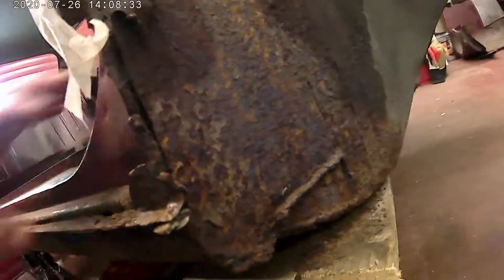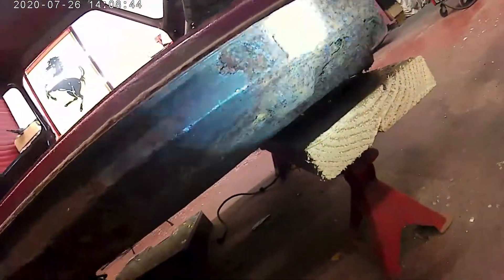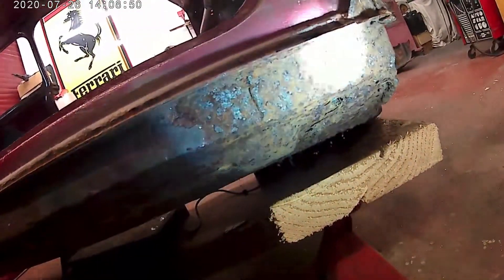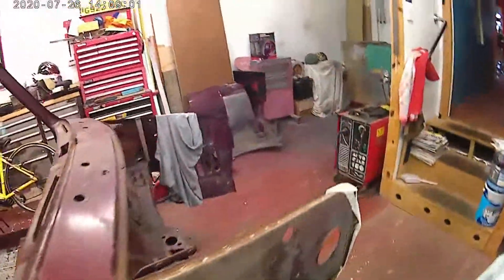That's a wee quick look at these front corners. As I said, same again. And as a previous conversation with Sean from BMC — as you can see Sean, it's because of somebody's bad repairs. Other than that, the car was probably pretty mint. It's been caused by somebody putting a repair panel in and not painting, not treating. And this, folks, is why you etch-prime everything as soon as you finish with it.